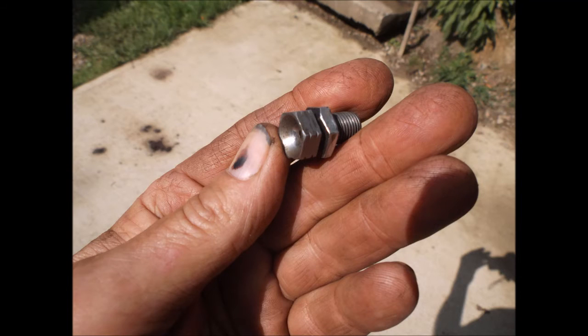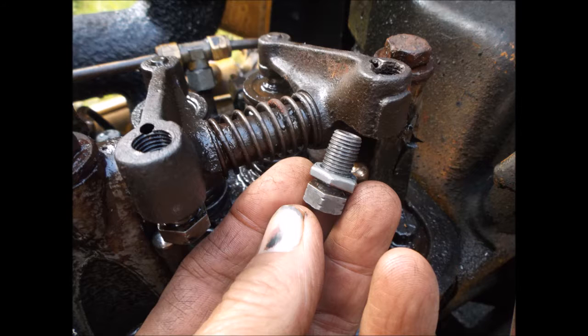The solution is to make a permanent locking nut. I used a 9/16th nut and ground the surface down to about half its thickness, so it's a real narrow nut. I used it in a vise with a bolt — not the locking bolt as I showed here, because it will be damaged — and I ground that down to fit. You can see here it's on the tappet or push rod bolt, and we need to reinsert it into the rocker.